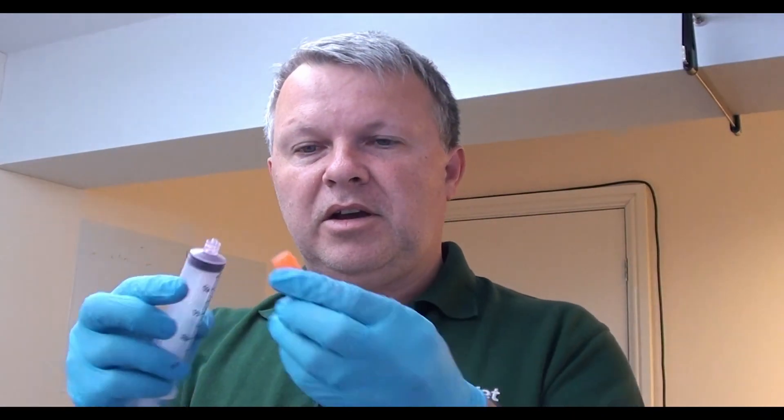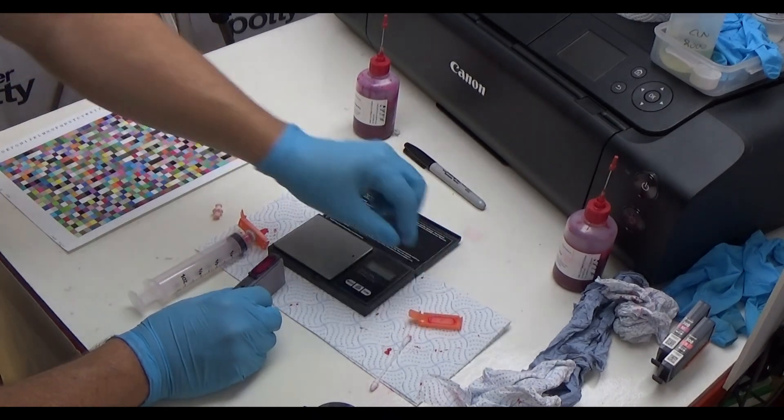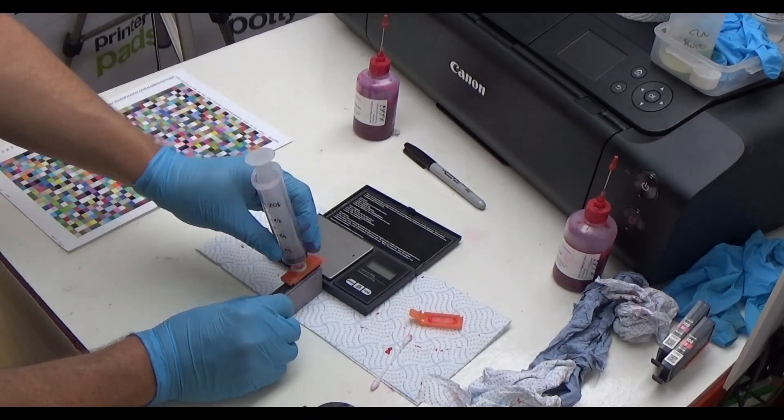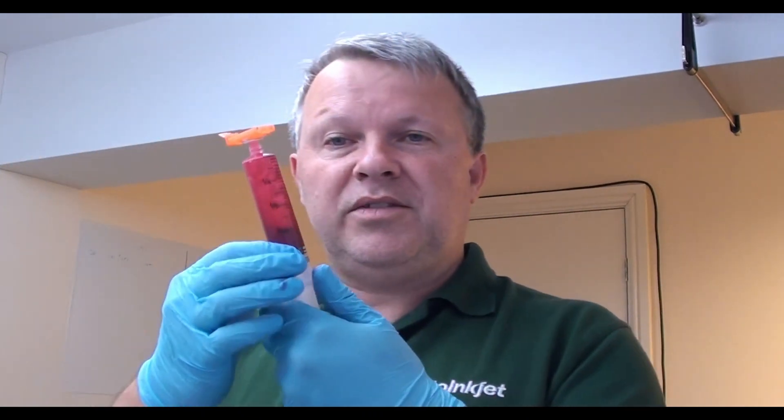So now that we've done that, we reattach our syringe to the flush clip, remove the storage clip from the cartridge, and reattach our flush clip and syringe to the cartridge. As you can probably guess, the next job is to suck all of that ink out of our cartridge. I want to get a good amount of negative pressure and that will suck the ink and foam out of there. That gets most of the original ink that was in there and also the ink that we just pushed in, so that anything that's left is diluted down to virtually nothing. Now all of the stuff we've got in our syringe needs to be dumped — you're not going to be using it again because it's effectively a mix.